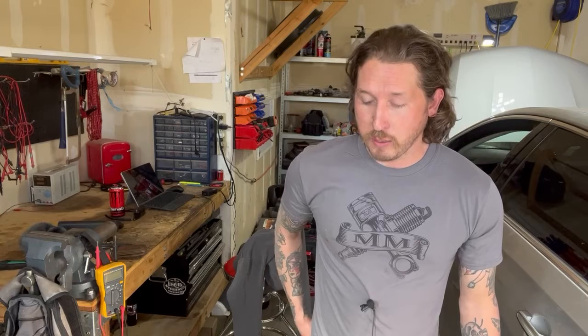Alright folks, well there you have it — that was another adventure in the garage. If you have any questions about your XTS let me know. It seems like really the biggest thing on this car is the lower control arms — if you have a clunk, you might want to try doing the lower control arms first. They're pretty straightforward. I think the only thing you'll struggle with is the torque rating is pretty high — I think one of the main bolts is like 175 foot pounds, so don't quote me on that but some of the torque ratings are kind of high for the control arms. Struts are pretty straightforward. I got you guys that tool number. If you have a small evap leak it's most likely that evap purge solenoid. And if your seatbelts go off — that's how you do your seatbelt. The driver side is identical to the passenger. Thanks for coming on another adventure in the garage — please comment, like, subscribe, and share, and I'll catch you guys on the next adventure.